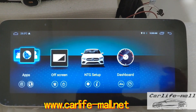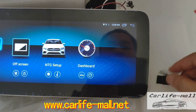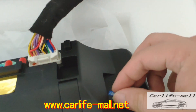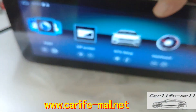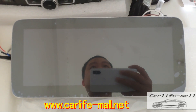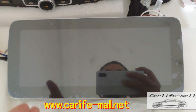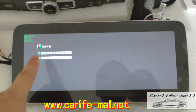Okay, what do you do. First, take out this card and insert it here — the first slot, with the label 'TF card'. You can check the screen shows no change. Then turn off the screen, lock the car, radio off, engine off, and then power on. You can check the screen — upgrading is starting.